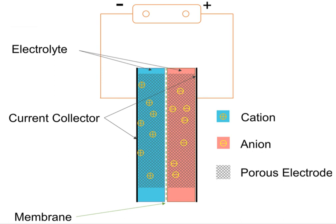The FIA, a governing body for motor racing events, proposed in the Powertrain Regulation Framework for Formula One version 1.3 of 23 May 2007 that a new set of powertrain regulations be issued that includes a hybrid drive of up to 200 kW input and output power using super batteries, made with batteries and supercapacitors connected in parallel (KERS). About 20% tank-to-wheel efficiency could be reached using the KERS system.